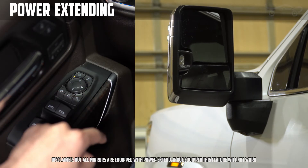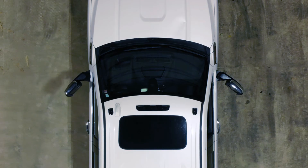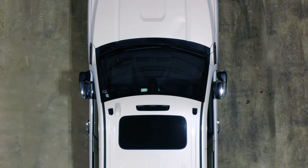To avoid damage to the mirror, be sure not to hold the arrow past the point of completion. In the event the button is held too long, a beep sequence of one long beep and one short beep will sound, and mirror extension will stop. You may see the passenger side mirror start folding or extending slightly after the driver's side, due to the modules communicating from side to side.